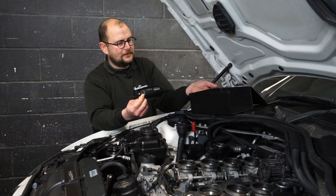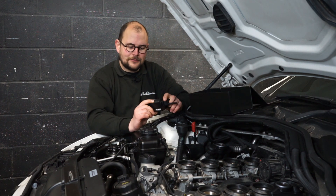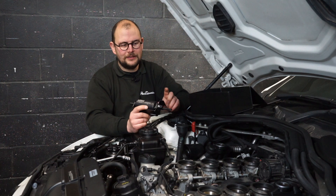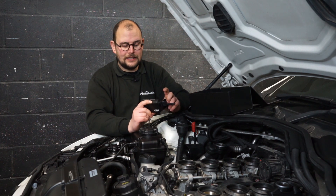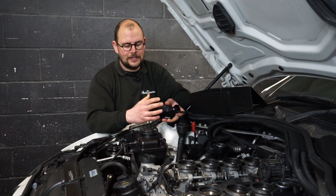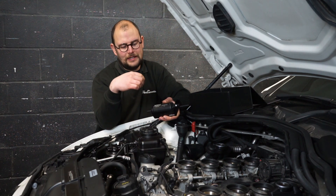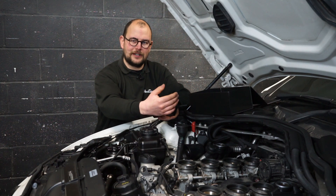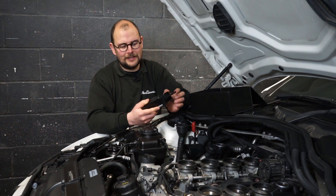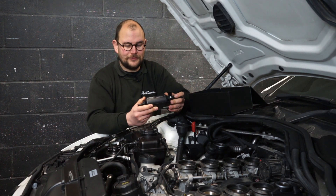It sits inline and it's a really lovely billet piece. Worth noting, it positions the fuel pressure sensor after the filter. A lot of people do a DIY bodge putting a filter on these cars and never sort out where the fuel pressure sensor sits. With any filter you get a pressure drop, so if your sensor is before the filter you're not monitoring actual rail pressure — which is what the ECU needs — you're getting skewed readings, leading to missed fueling. The NRW kit relocates the sensor to after the filter for accurate readings. It's a complete, fit-and-forget item.